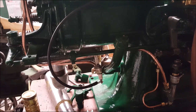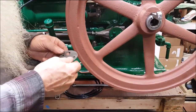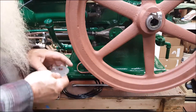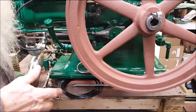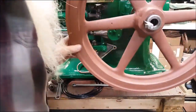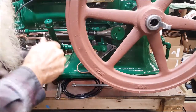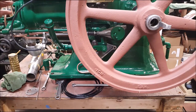I think we'll be all right in the spark department. The reason this cover that's on there — that holds that linkage together right there — it has two marks in it, two hash marks, one there and one there. There are two on the cover that's on there. Quite interesting — I'll show you what it's for. It's to verify that all your gear train is in correct mesh. So what you do is come around — I have to have the plug in it so I know when it comes on compression.